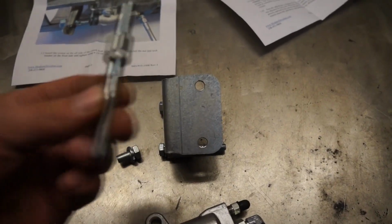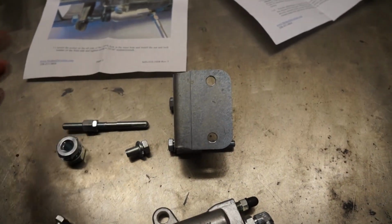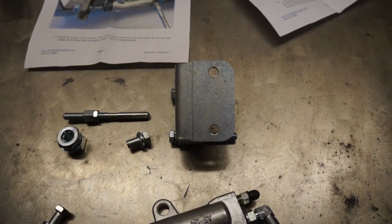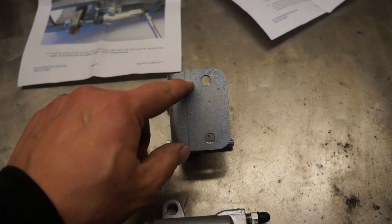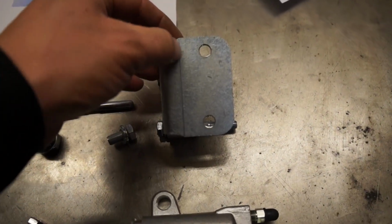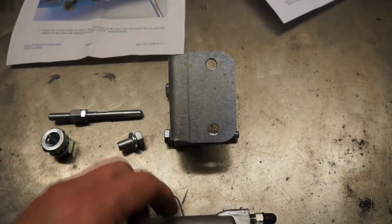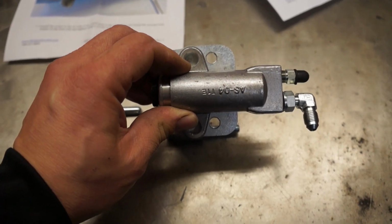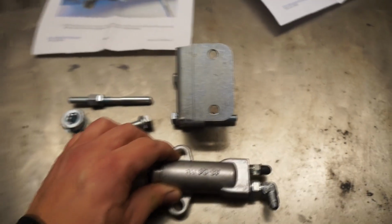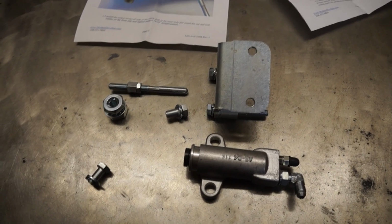Now, sorry for that. You do have some adjustment, but in the case that you have, let's say, the wrong clutch kit, I will recommend you drill new holes pretty much where you get to see the line here. I'll get back to you with the proper sizing and tap and drill bit to use for that, but you get the point that you will have to move the whole assembly there. Now I know it might sound confusing for now. We'll get back to it later on when we work on the transmission.